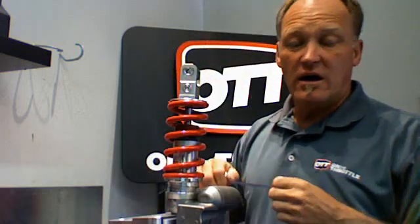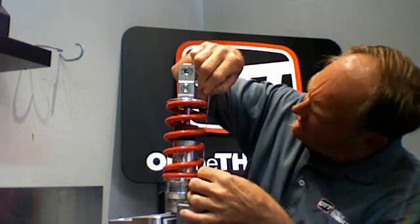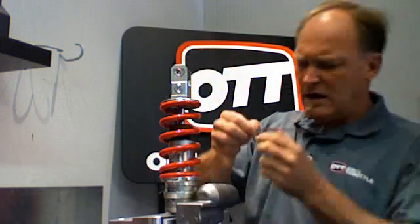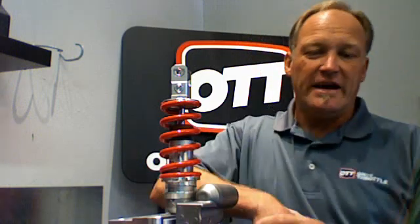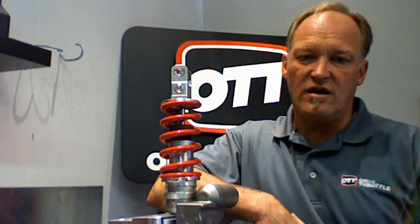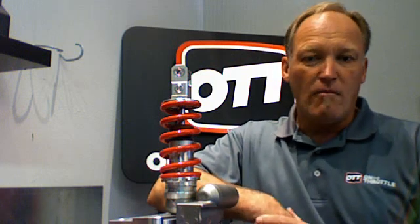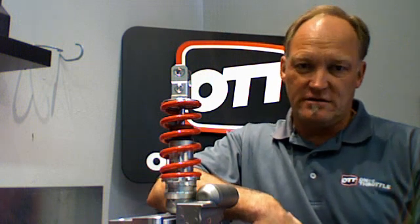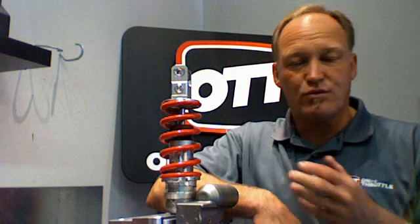We had 150 millimeters on our lowest setting, and now at the highest setting we have 143 millimeters. That gives us an extra 7 millimeters of preload adjustability. The maximum you'd want to go is 15 millimeters, so with a ramp adjuster we're getting short-changed — we can only access about half of what we're looking for in terms of preload range.